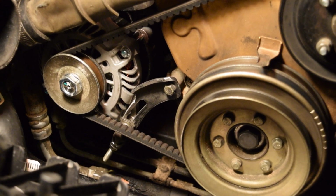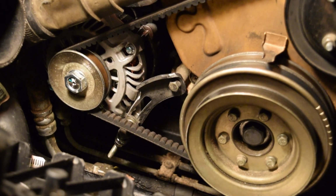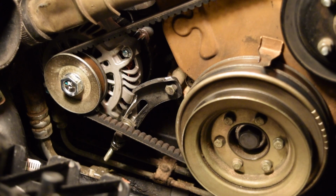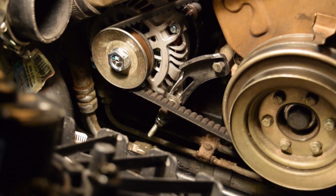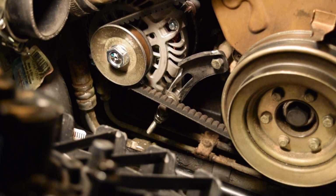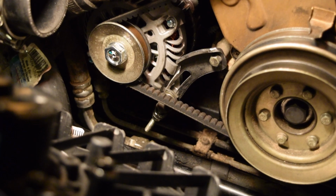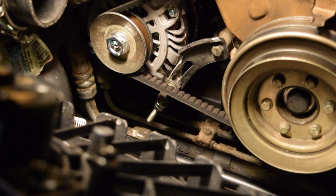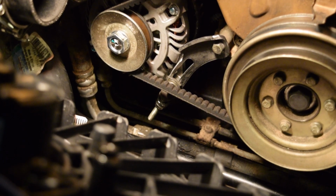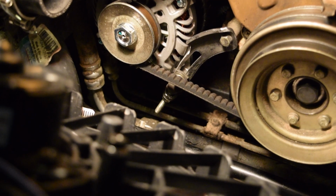it's at. I think if I were to do this again, I would have left that bracket right there just a tiny little bit longer, drilled the hole further up, and that would have given me a little bit more room because the tensioner is actually kind of maxed out where it's at. So even though we're at a good tension, if we ever had to go tighter, that would be a problem for us. We could put a washer or two on the outside of it. That would push the nut back a little bit, and it would keep on the threads instead of running into the little non-threaded part.